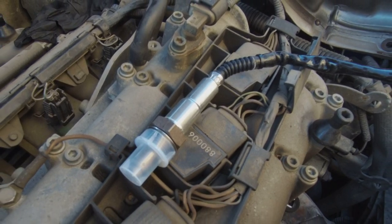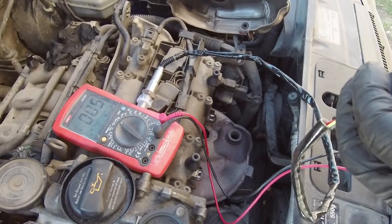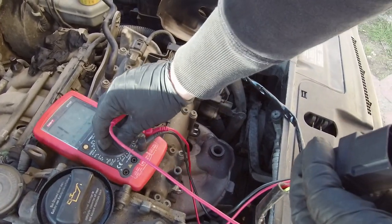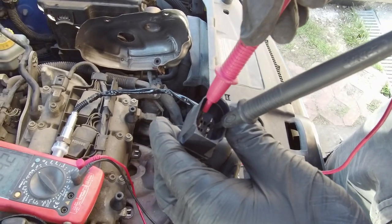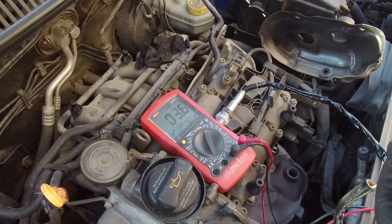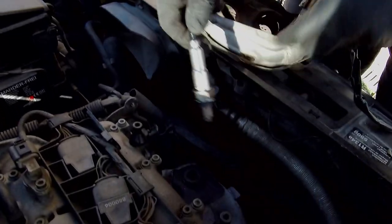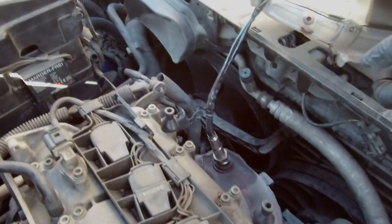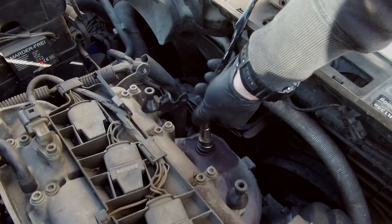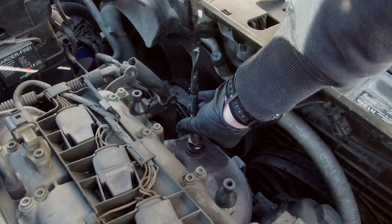Now I'll show you the working heating circuit on the new oxygen sensor. First, circuit test — and it's ok. Set the multimeter on resistance and it shows 3.7 ohms — that's perfect. Time for fitting. Take the sensor wire and carry it through the heat shield. The new sensor has a bit of anti-seize grease on the thread, which will make it a lot easier to remove when we replace the exhaust manifold. Once you get it threaded in, tighten it up all the way.